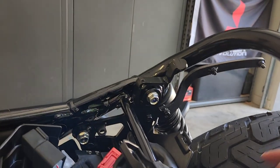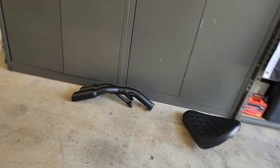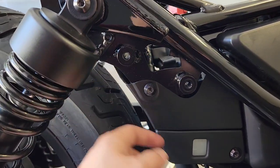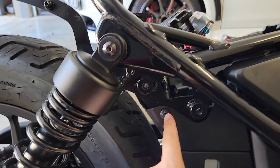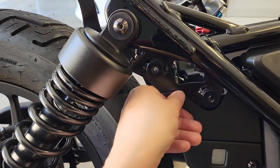When you put these two bolts in, the other thing you've got to think about is that this plastic cover needs to be on the outside of the bracket, not the inside. I've just hand tightened the two 14mm bolts and then I've got this M5 bolt in here.